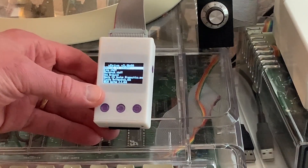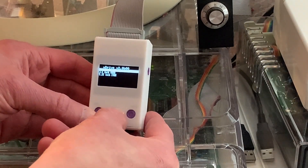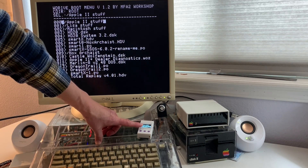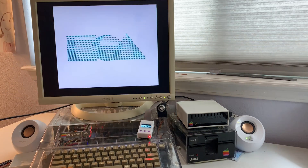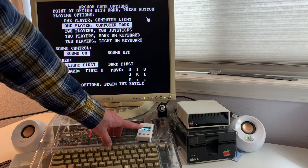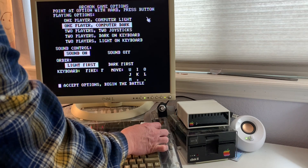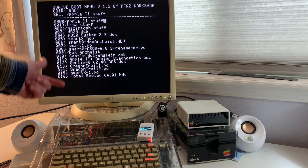Using the LCD screen to select disk images is straightforward. You can use the up and down arrow keys and the middle button is select. If you have a subdirectory, you can click on that to go down into it. I'll go down into the 5.25-inch directory and then down into games, and I'll select Archon. Now that I've selected a disk image using the W-Drive itself, I can turn it off and then back on, and it should remember that was the disk image we chose and boot it right up — which it does. Once selected this way, it will remember every time you boot. If you want to get back to the main disk menu, just hit the reset button on the side of the W-Drive and then hit reset on your computer, and it should boot up to the main W-Drive boot menu where you can select a different disk image.